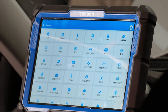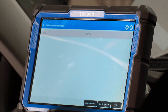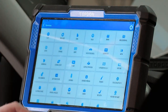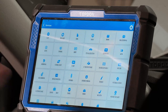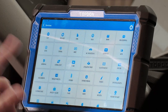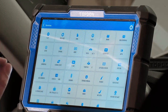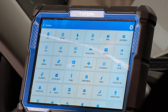Services is a menu for quick relearns and resets. If you've got something like an odometer change — maybe you replaced a used module and need to change the odometer on it — that's the menu to check. If you don't find the option you're looking for here, remember that you may also find it inside the control module menu when you do a normal diagnostic scan. So the services menu is one place for resets and relearns, and the traditional diagnostic menu is another.